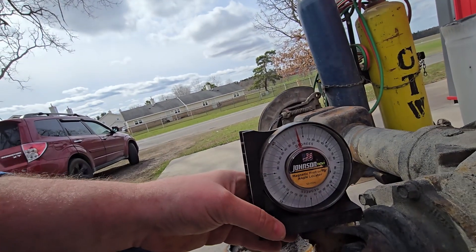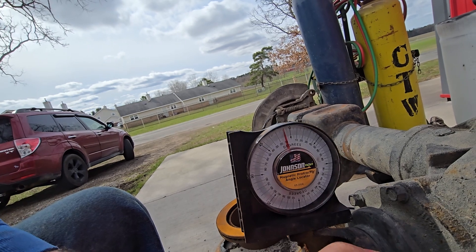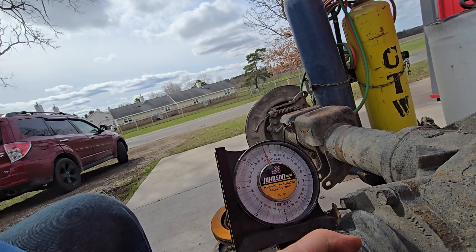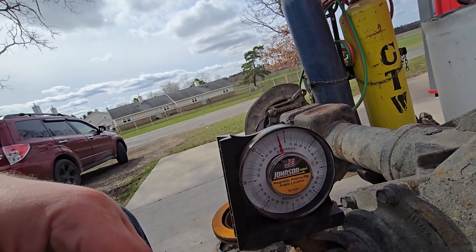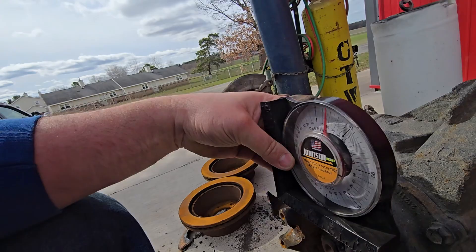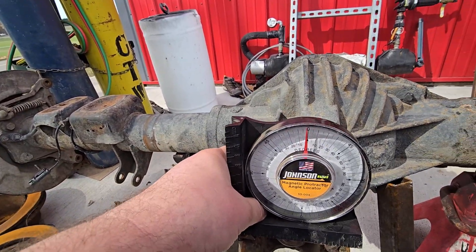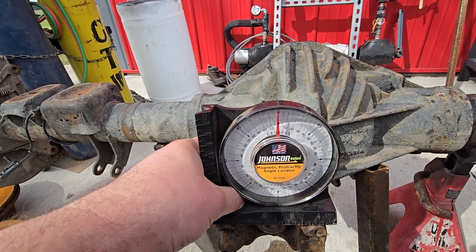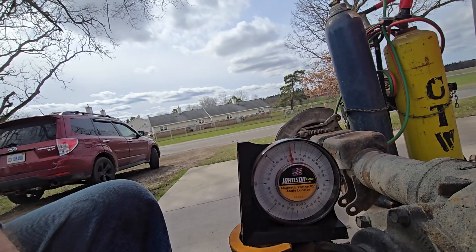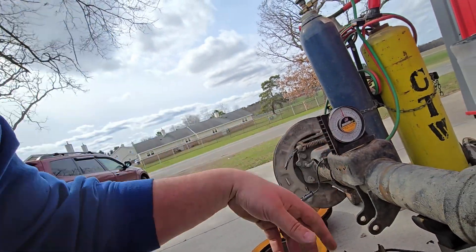Maybe that's what they were. You can measure it off the pinion too. You have to be careful — you can turn it quite a bit and it doesn't really affect the angle so much. For anybody wondering if it was level — it doesn't affect it that much. So this one's about 8 degrees down, and I'm pretty sure the truck's probably 6 degrees down.